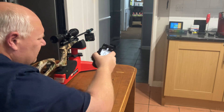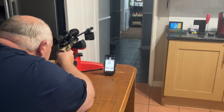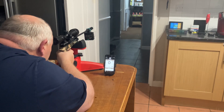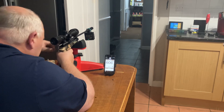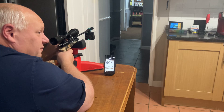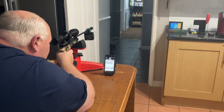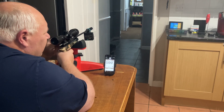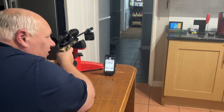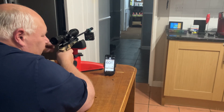I've made sure I've got the sound on this time, unlike yesterday. We're going for the red, white, and blue ball target. I've not actually zeroed the scope — I've literally just bolted it straight back on, but it shouldn't be far away. We're back up to nearly seven foot pounds, which is what I expected this to be. 599 fps, 6.7 foot pounds — it's not overly warm in here, 16 degrees at the moment. Obviously CO2 gets a lot more powerful with heat. 601 fps, 6.7 — we've still got that consistency which I like.